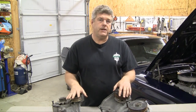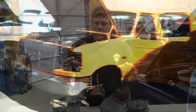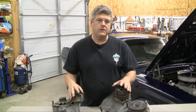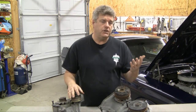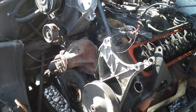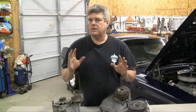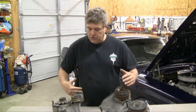There are systems out there for pretty much everything. Regular passenger car systems in the Ford line were different than the Fox Body Mustang, which were different again from the Explorer and pickup truck — every one had something for the Windsors. You just have to make sure you have enough width and height in your engine bay to make these work. On the Chevy side, the 350 pretty much stayed the same throughout. Measure twice and install once — you don't want to buy a whole system and find you don't have hood clearance.